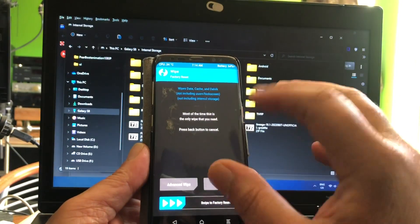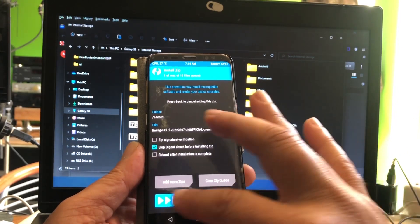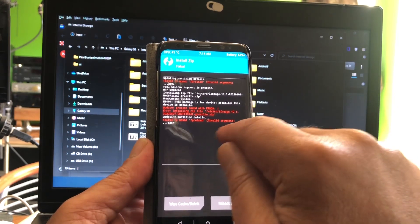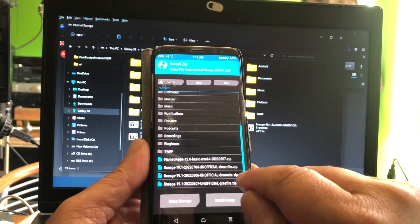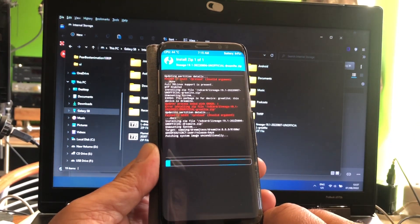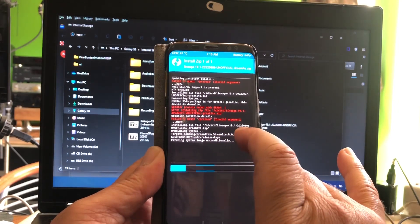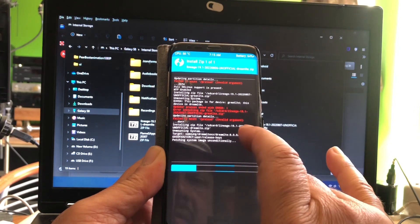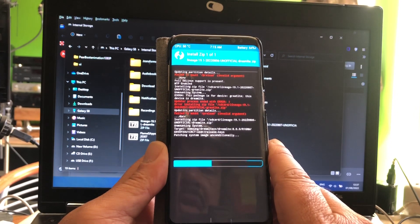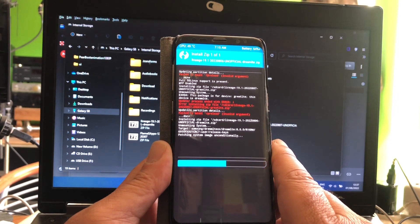If you're going to do a clean install, this is what you should do: you did a wipe already, you reboot back into recovery. We would see what happens if you flash the one for Great LTE — you should get this error. Error updating file. Invalid. So you need this one: Dream LTE. You see that? From the 6th of August 2022. So this build was already released two days ago — it was created on the 6th, 08. Today is 07.08. And the Great LTE was finished today and uploaded today.